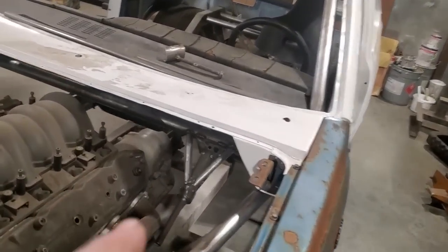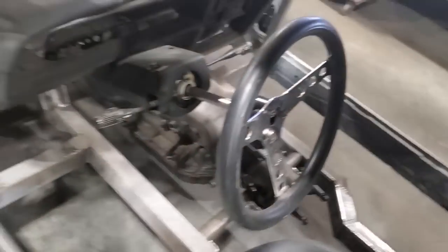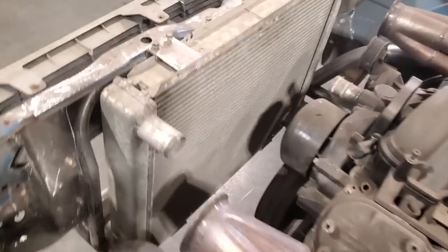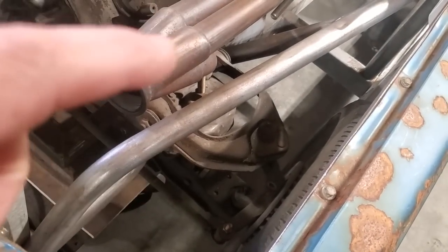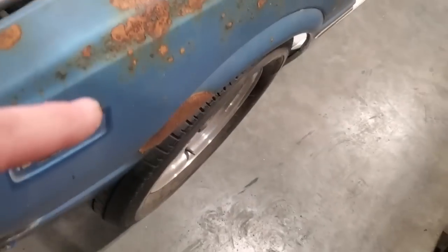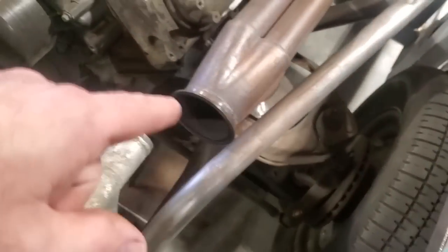In the last video, I went and built and installed the steering column for Crusty. Got the dash installed, got this all worked out and everything — all I've got to be done now is finish welded in. The next thing I want to tackle is the rack and pinion. I put a Mustang 2 front suspension in this car and I narrowed it four inches so that the tire would sit proper in the wheel well here with these skinny tires. I ended up narrowing the front clip four inches.